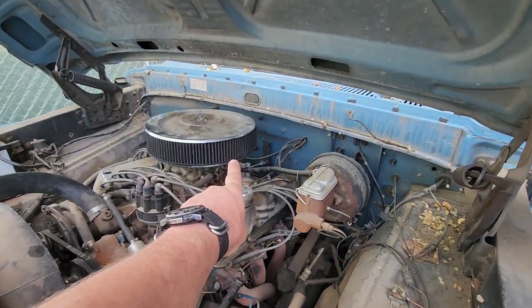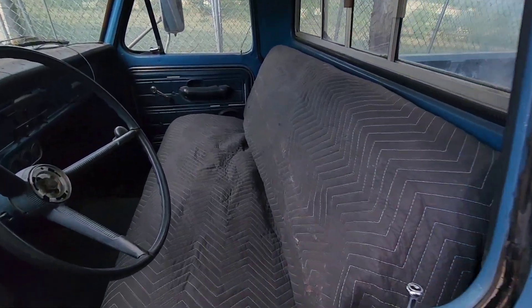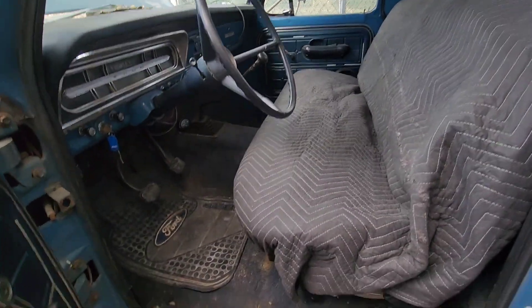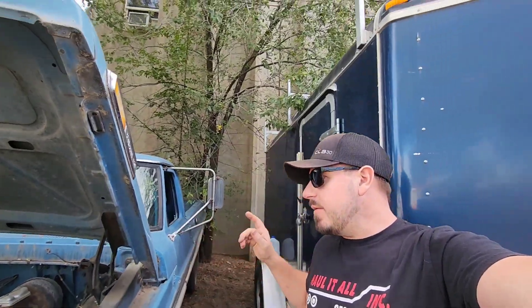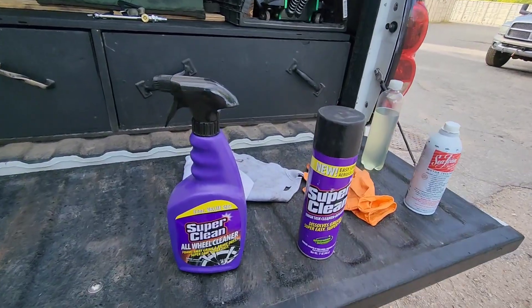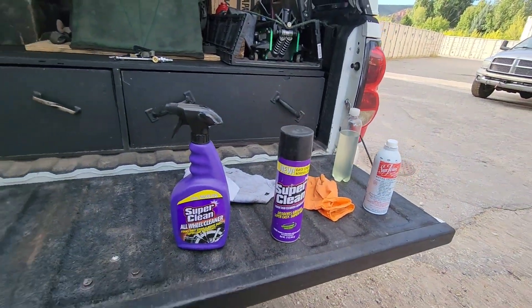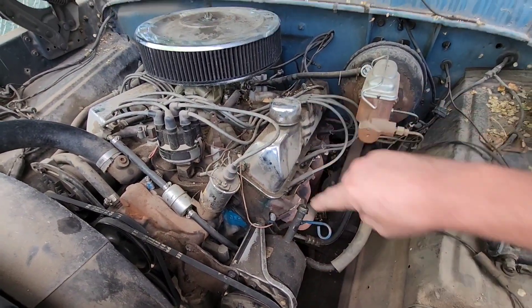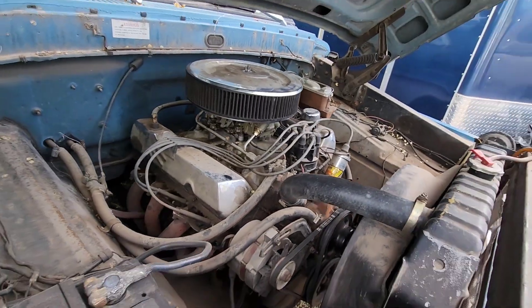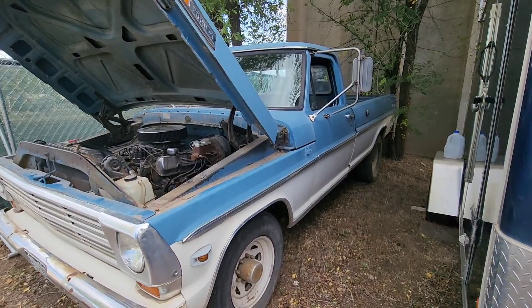All right, we threw the air cleaner back on there. I'm gonna put a plastic bag over that before I start washing down under hood. We blew out the interior and got a custom seat cover - beautiful custom fitment. I'll be able to jump in this thing without getting all fibrous. We also got some stuff to degrease under the hood - Super Clean. Awesome products, and Super Clean's actually a sponsor of my little channel here. Try it out if you want to - pretty affordable as far as most degreasers go and seems to work pretty well. I forgot to mention, the valve covers were leaking and all the bolts on both sides were hand tight, so I went ahead and tweaked them down a little bit.